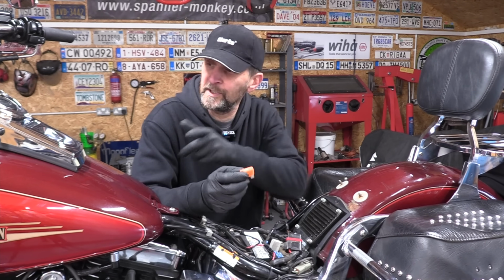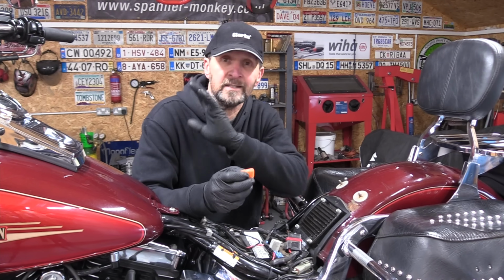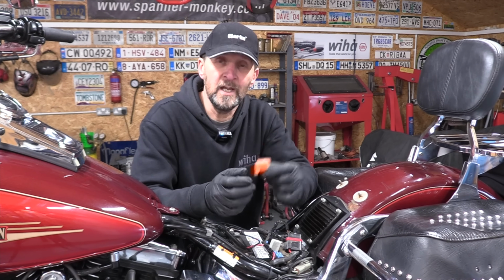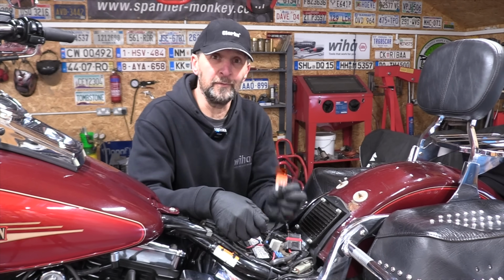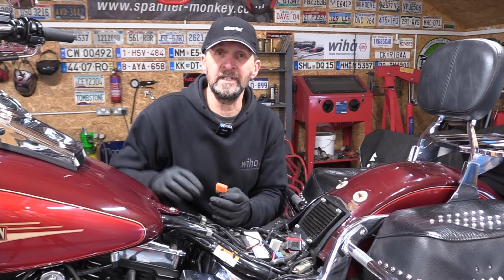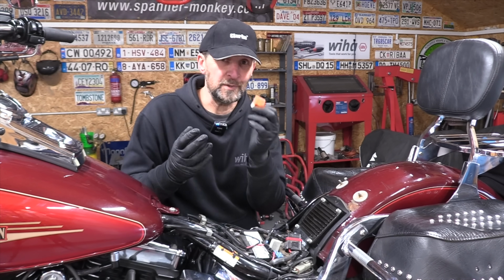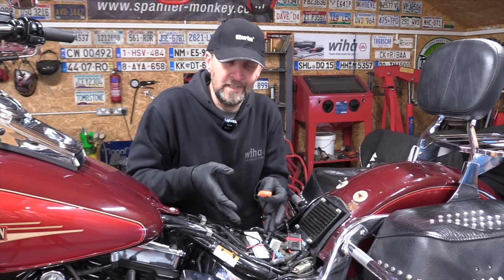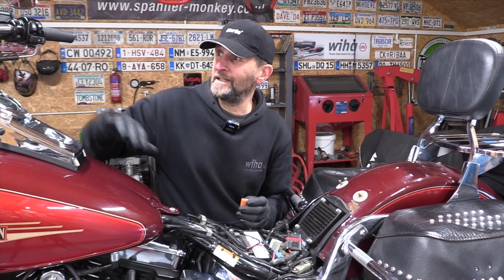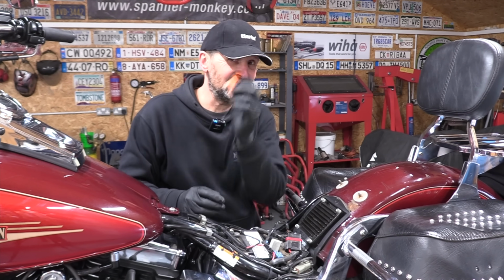And it works because when you turn on your ignition with your fob in place, it deactivates the alarm. That's how the system's designed to work. Then with the alarm deactivated, because we're ready to go for a ride, we power it down. And by pulling out the fuse, power everything down, the alarm system was powered down whilst deactivated. So it can't sense the voltage drop now and set itself off, which means I can now change my battery, make a new installation of the new one, tidy everything up, pop the fuse back in, the ignition will light back up again, and the alarm system will never know what happened to it. Real easy.